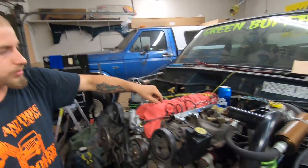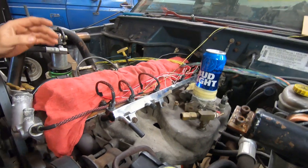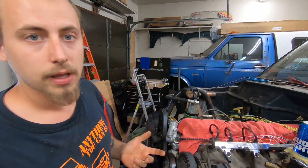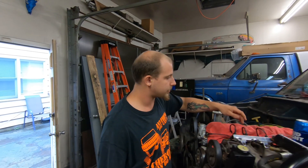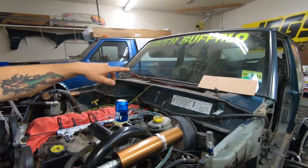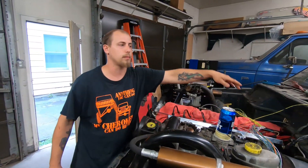We started wiring up as you can see — we got the first three. The injectors are pretty easy to wire, especially when you have this awesome wire loom from DIY with everything labeled. There are eight spark outputs and eight injector outputs; obviously we're only using six of them. I'm using the firing order to match injectors A through F and I'm going to do the same thing with the spark — match the firing order just to keep it simple.